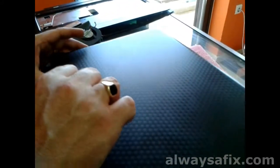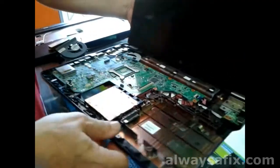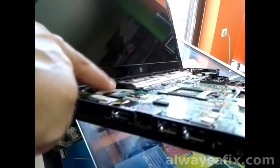The device overheats and it shuts down. So for this particular model, I will blow some compressed air through these vents and all the dust and hair and whatever is blocking it will come out. Afterwards, with a flashlight, I will make sure that it's 100% clean and then we're going to put it back together.